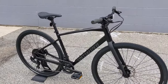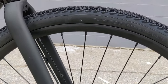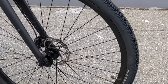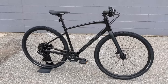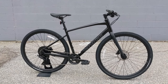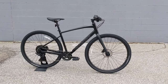The stem goes to a Stout Mini 15 millimeter rise handlebar. The wheelset carries those larger tires on 700c double-walled alloy rims — 32 hole, 22 millimeters deep, and 21 millimeter internal width. That wider internal width gives a little extra durability and more support for the big tires. Specialized has also used a Schrader valve, meaning you can use a standard pump or even a gas station pump. The actual weight of the Cirrus X 2.0 in a size medium comes in at 26.92 pounds.